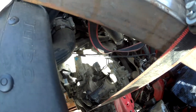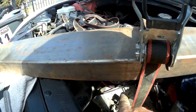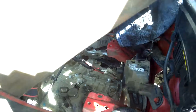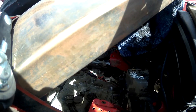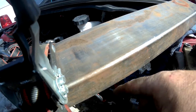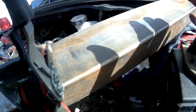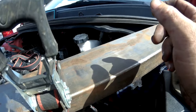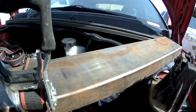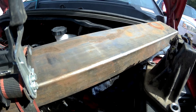I ended up using the strap — lifted this end, put the jack towards the front, and I've got two of the bolts in. Transmission is in — I just need to get the top ones in so all the weight isn't supported on just those two. Once I have the two upper transmission bolts in and snugged down, the next step is to put the transmission mount back in so I can get the support bar out of the way and finish putting all the bolts in safely.